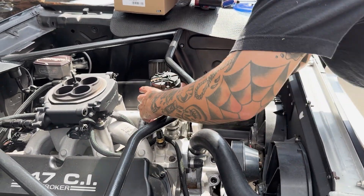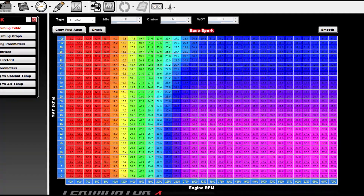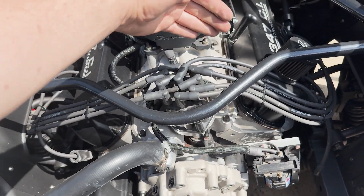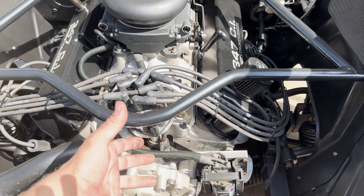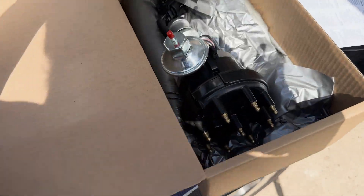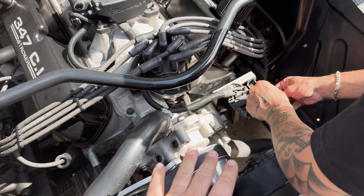We've been using a ready-to-run distributor. What we're trying to do is get full timing control without spending four or five hundred dollars on a fancy Holley-supported distributor. This ready-to-run style distributor without a vacuum advance has worked fine, but we think we're leaving a lot of power on the table, especially down low. We're going to replace it with an OEM-spec Cardone magnetic pickup distributor. The Holley Sniper is compatible with magnetic distributors — Holley intends you'd use an MSD or Hyper Spark style, but it's very possible to use an OEM style distributor if you know how to set it up.